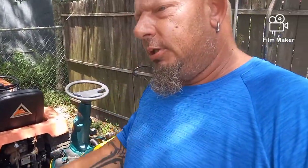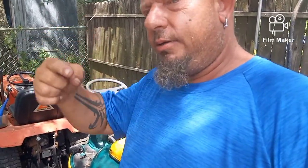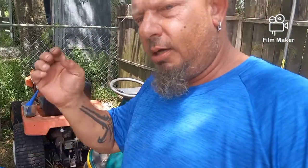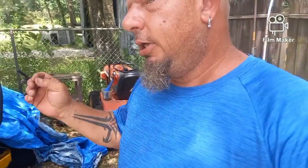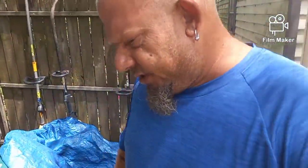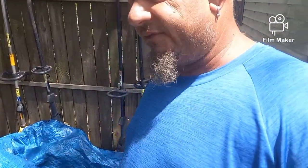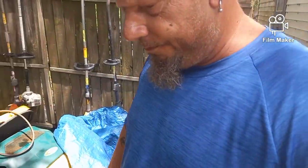The first thing I did was pull the oil filter off, and the o-ring had fallen down. To double-check that was the problem, I put the o-ring back in place, screwed the filter back on, filled it up with some old oil, and sure enough it wasn't leaking anymore. I'm going to drain the oil off camera, change the oil, and put a new filter on.